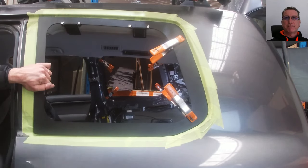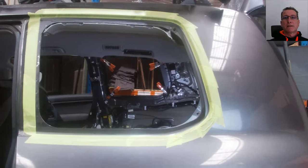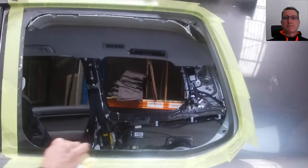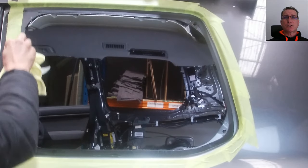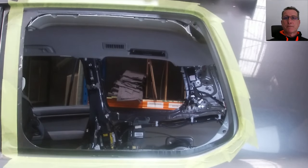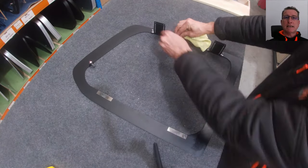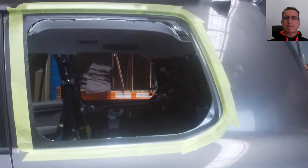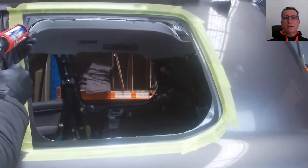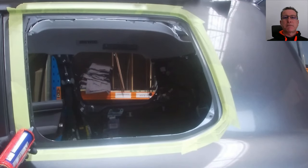Once we're done we can remove the frame, and then it's time for a really good cleanup — getting rid of all those fingerprints and greasy paw marks from around the window so that we can go on to applying the glue. This is just a simple wax and grease remover, anywhere where I might have touched, just to ensure a really good bond. We're also going to do the back of the frame, make sure that's all nice and clean and free from any grubby fingerprints. Now applying glue — approximately a five millimeter bead towards the inside edge, increasing that bead to six or seven millimeters around the corners.